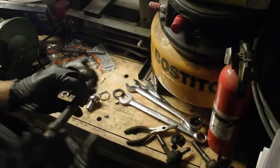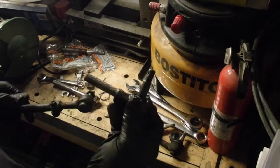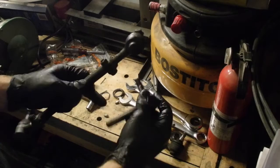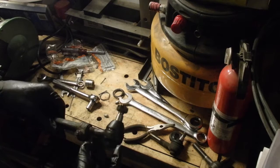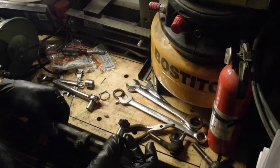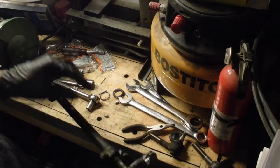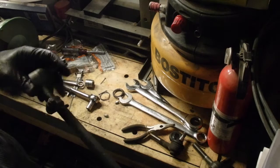Small unfortunate discovery - one of the two that I bought for the driver's side tie rod is incorrect. Whether I ordered the wrong one or got duplicates, the thread pitch is wrong, so I can't use it. I replaced the boot using a new castle nut and put it back to where it was. Plenty of grease was still left in the joint, so that's good. It moves freely, there's no binding, no rust pitting, no discoloration - so we're going to call that good. It's not ideal, but I'm not going to hold up this project.